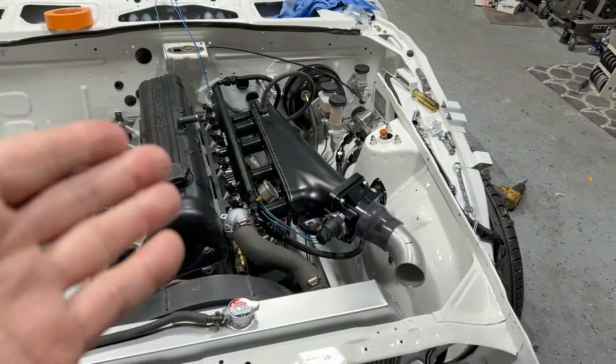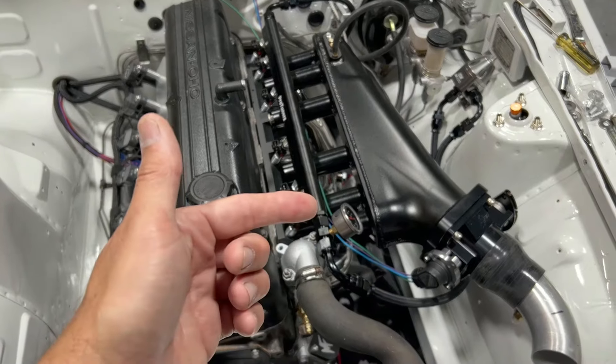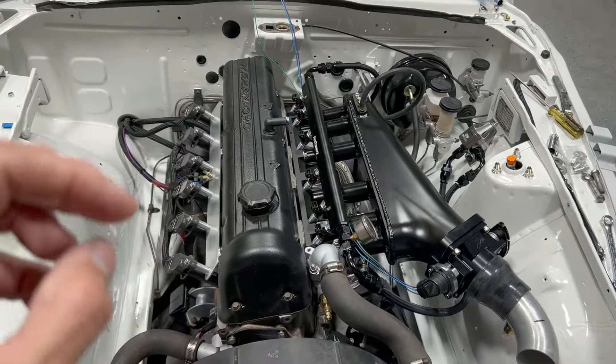It's just like you get a little less fuel efficient — it's really not going to run any worse, it's just going to burn a little more fuel. We're also going to lose the ability to individually change injector trim on each cylinder. Like if you were running EGTs and you had a hot cylinder and you wanted to add a little more fuel or a little less timing in that particular cylinder — that especially matters if you're running a really high performance engine.